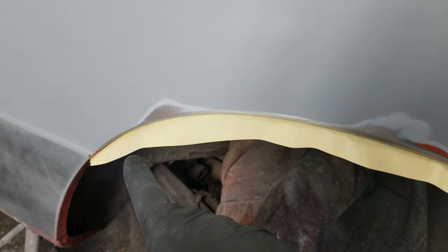This side, I've got a couple of cut throughs. This is okay here. This one right here, I'm gonna put a little primer over just to level this area a little bit more. This one's actually straight. Same thing here, I rolled the fender just by hand with hammer and dolly and had to come back and tap this a little bit in a few places. And then I sanded this out with 400 just to get all the hammer marks out. I hit it with 180 right on the edge first and then came back with 400, about a 6-inch area around it. So this is gonna get epoxy.